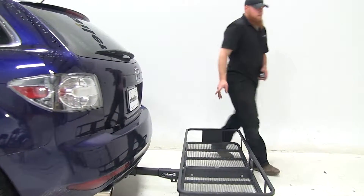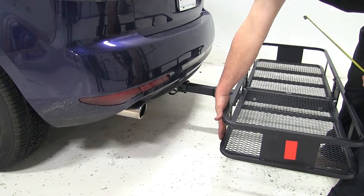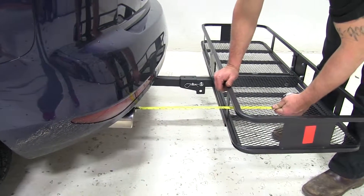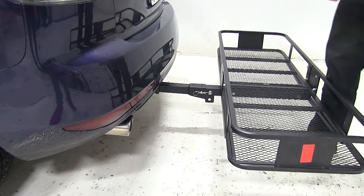Let's close that up and give a couple of measurements from the back of the exhaust. This is going to be for anybody carrying anything that's heat sensitive or perishable — you're going to want to know your exhaust standoff. It's going to be about 14 and 3/4 inches on both sides, since this vehicle does have dual exhaust.